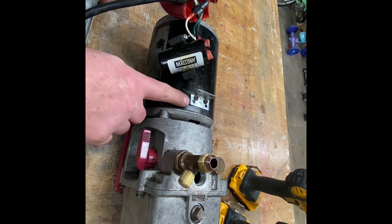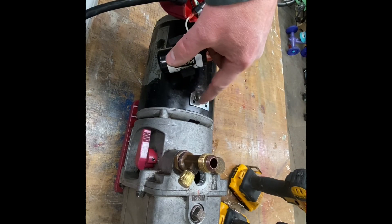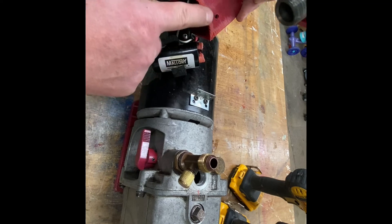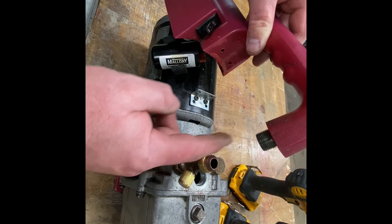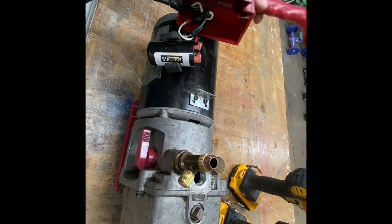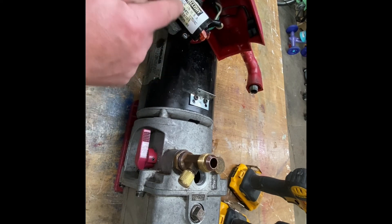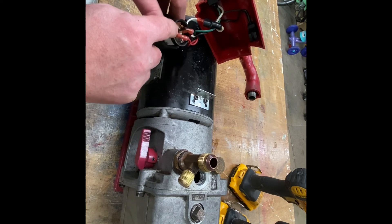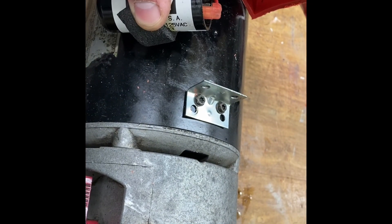While putting it back together, I found a little bracket in my drawer. I drilled it out and put the factory screws back into the motor to replace the broken plastic — cut the broken plastic off, drilled two holes, and I'm going to put some pop rivets in there. Most of the weight is carried by the bolt on the pump side anyway. Interestingly, the capacitor is the original — made in the USA. Also found a melted connector on there, so we might have to make a little repair on that.